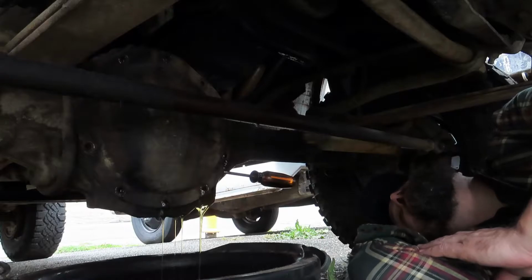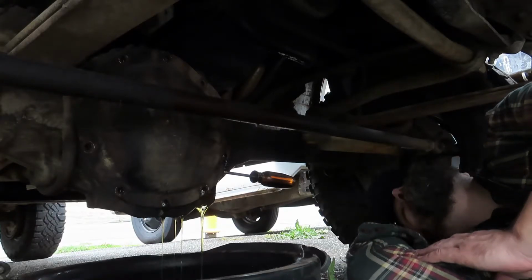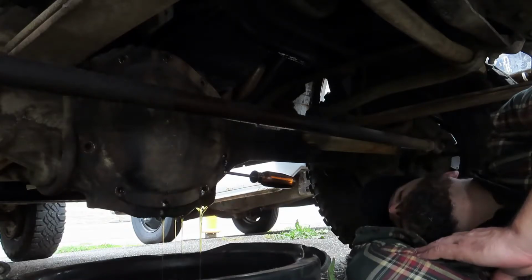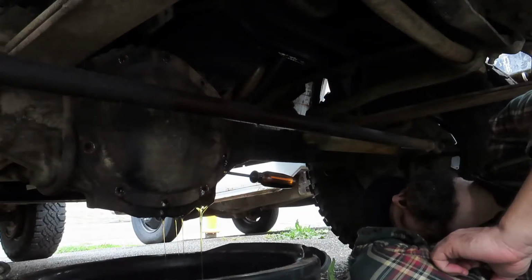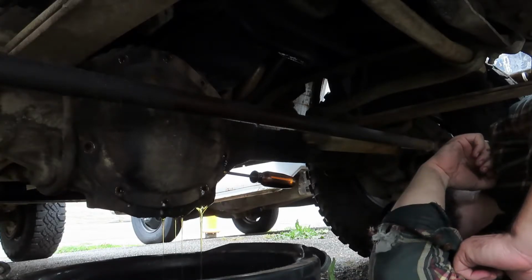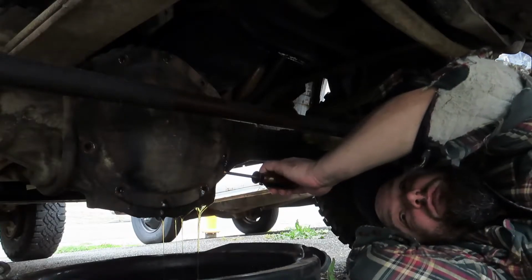She's looking a little damp under here. Those headers are looking pretty crusty too. Supposed to have been ceramic coated, but that ceramic coating's burning off. We won't be getting too many more years out of those at that rate. Holy cow. It looks like I may have something going on at the front seal on the pan, or hopefully the front main isn't leaking. I know the rear main leaks a little bit. Transmission's got some drips on the bottom of the pan. It needs to be done. I may just tackle that myself. Never done a transmission. Pull the pan and change the filter.